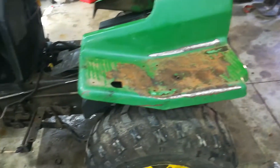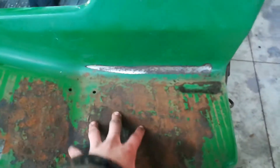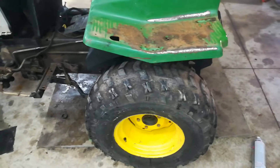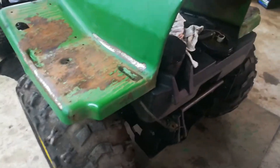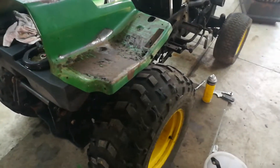Right now I'm juggling a lot of things. I'm gonna clean this up — I'm not too concerned about this area. I'm just gonna scrape as much as I can off and sand it down, get rid of all the rust. Because this will be covered up by the foot pan anyway. Just gonna make sure there's no rust to spread, and just enough so it doesn't rust up again. It was packed with mud and that's why it rusted out.